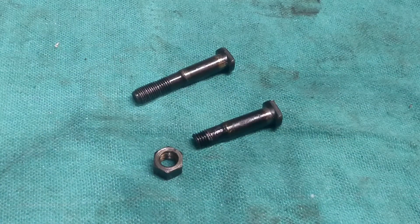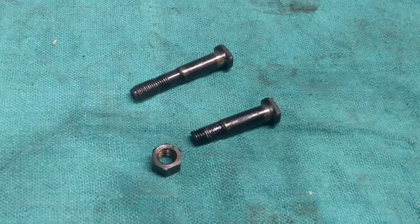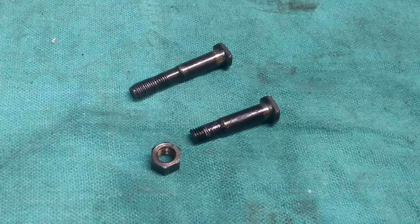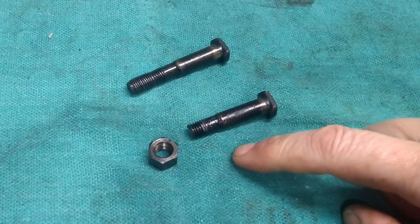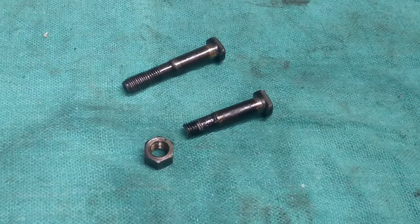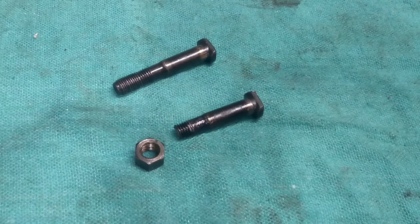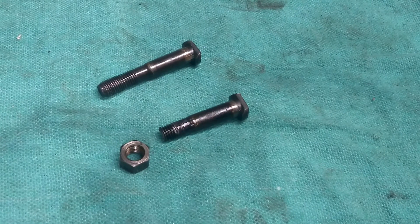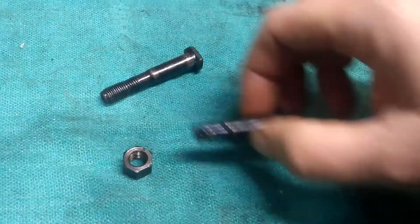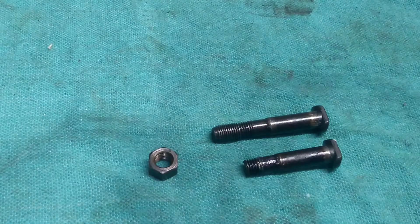75 sure sounded high to me, but I said, oh, the internet could never be wrong. So I set the torque wrench to 75 and went at it — and this is what you end up with when you do that. When I went back to find that page, I found the same page again. What I had used was the torque spec for the connecting rod bolt on a 426 Hemi. Further down on the same page, it did have LA motors as 45 foot-pounds. So you end up with one bolt broken off, and the other one is kind of all humped out and then skinny — looks almost like a Coke bottle — compared to a normal one.